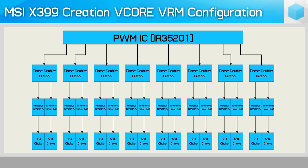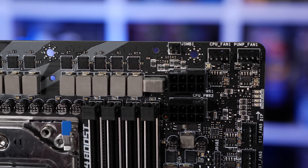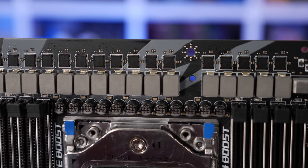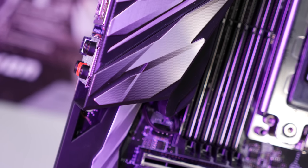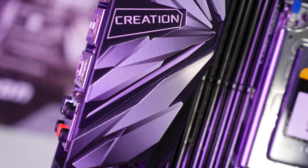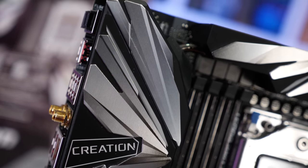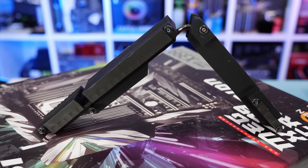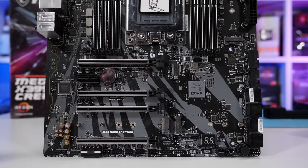The Infineon power stages carry a 70-amp rating, though there's no publicly available spec sheet for these parts. Even so, they are basically overkill for the 32-core 2990WX, and that's what we like to see. Feeding power to the board are a pair of dual 8-pin connectors. As amazing as the VRM is, it will still need a decent cooler for overclocking. MSI has gone with a massive pair of aluminium heatsinks connected via a nickel-plated copper heat pipe. They aren't finned heatsinks — just slabs of aluminium — but given their size and the VRM quality, I expect they'll still work quite nicely.